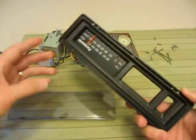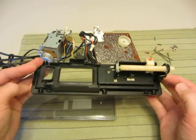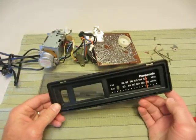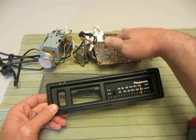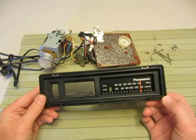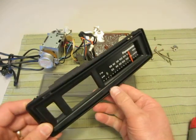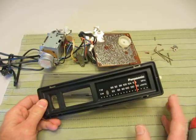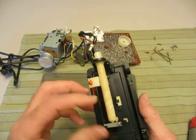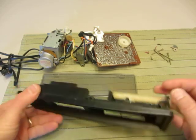Now I've got my lens and I can clean this out really good. Plain soap and water is your friend. You can use alcohol, or you can actually use ammonia, which I highly recommend — ammonia won't hurt anything in here. Keep it off the circuit board, but it'll clean out that black smoke you get in there from old electrical use. Take distilled water and rinse everything off. This area uses white lithium grease, so give it just a little bit — you don't need a lot, because if you put too much it's going to pick up a lot of dirt.